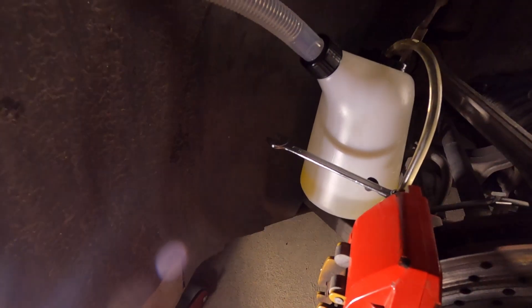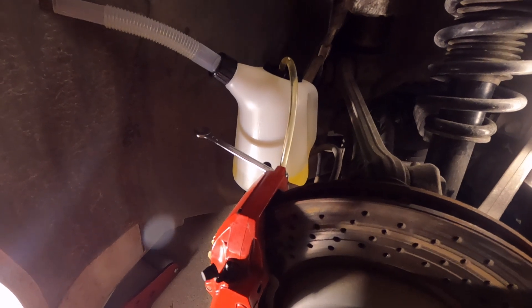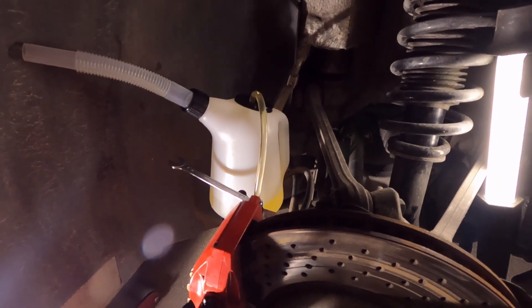I'm taking out 250 milliliters on the inside and letting it run for 10 seconds on the outside, so I'm up to 750 milliliters in the rear — because it has the longest stretch of piping. Then I'm going to do the last 250 milliliters in the front.